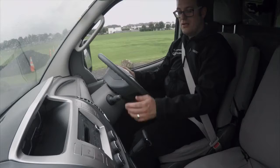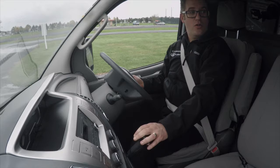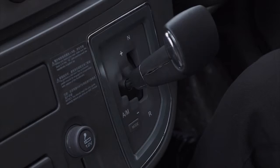For most people, however, the preference is to leave it in automatic mode. To get it back to auto, just shift the gear lever back to the left. One other thing to know is executing hill starts. On LDV product manufactured after July 2015, these vehicles are fitted with hill start assist, which means when you take your foot off the brake, the handbrake will hold the vehicle for three seconds. Simply lift your foot off the brake, let the idle come up, put your foot on the accelerator, and away you go.